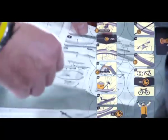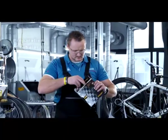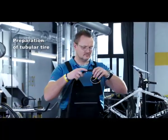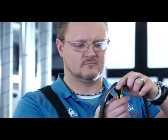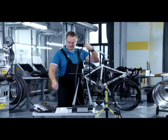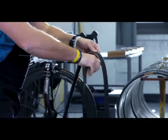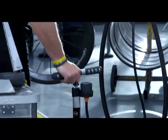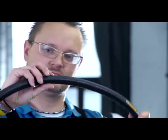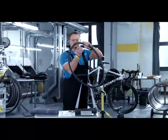To facilitate the mounting process and to ensure that the tire sits as well on the rim as possible, you should allow the new tubular tire to sit on a dry rim for several days inflated. Remove the protective cap from the valve and unscrew the valve. Press the valve towards the tire so that it opens — only in this way can air get into the tire. Pump up the tire until it just takes on its round shape but can still be pressed together easily. Screw the valve shut once again.